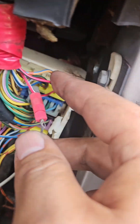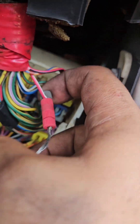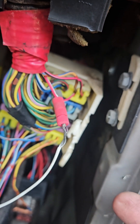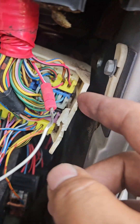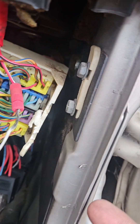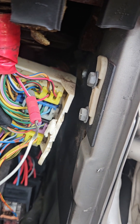After some testing between these two wires, the red-white wire — as you can see — is the actual speedometer wire and I got it working. It's a bit noisy, but I expect that because of the age of the sensor and because it's not properly wired up yet, so we're going to get that wrapped up now.